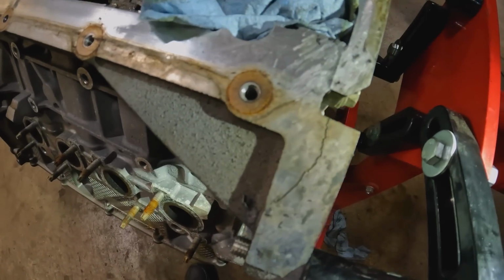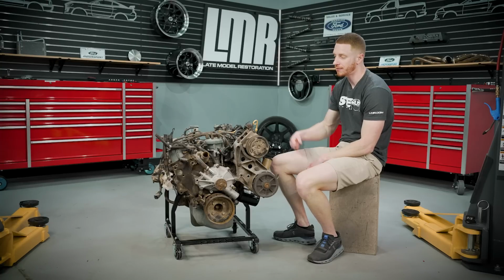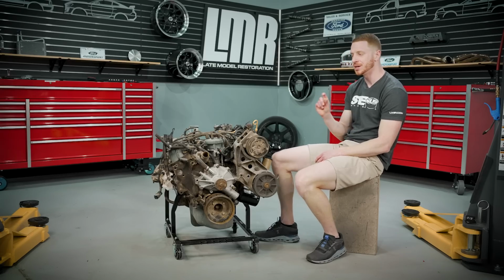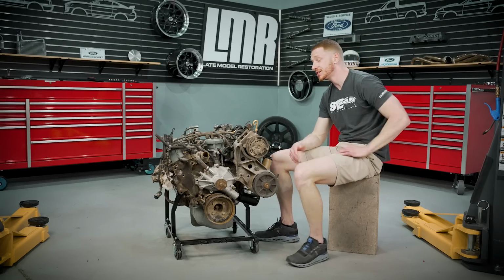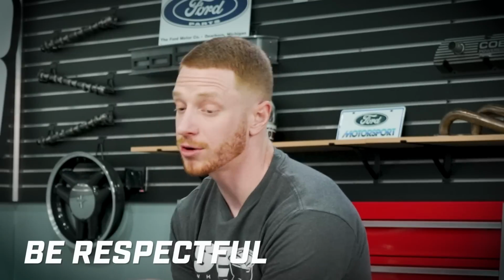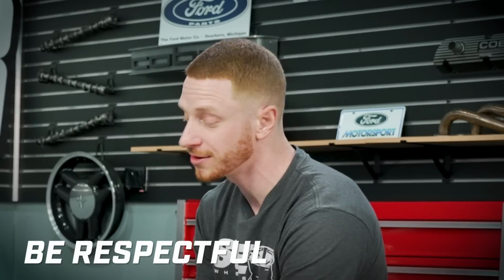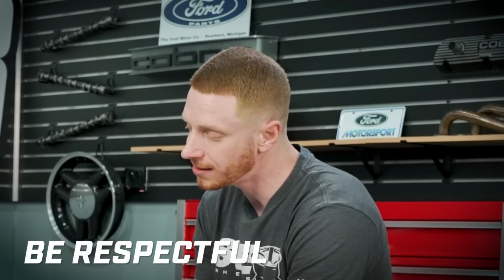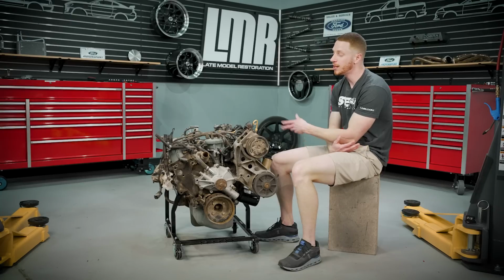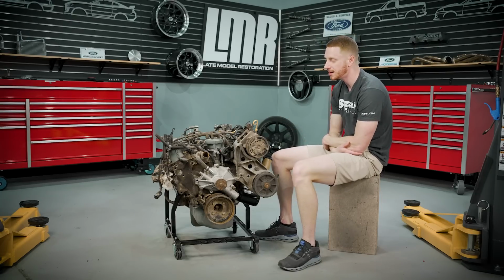Didn't really talk about things that you may not find just due to the space. You may not find a crack in a block. You're not gonna carry around your Magnaflux tool and start Magnafluxing an engine block at somebody's house. I mean, you might have done that or you might do that, but that's slim to none. And there's gonna be areas on these engines that you just can't look at, okay? Yeah, you can pull all the stuff apart you want to, and that's all gonna be up to the discretion of whoever's selling the engine. They're like, hey man, if you're just tire kicking, you're not taking my stuff apart. I'll let you pull a valve cover, I'll let you pull a spark plug and do a compression test and look at the cylinder walls, but outside of that, no, you're not taking this thing apart.